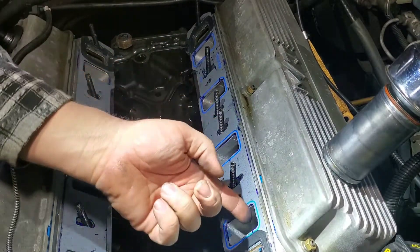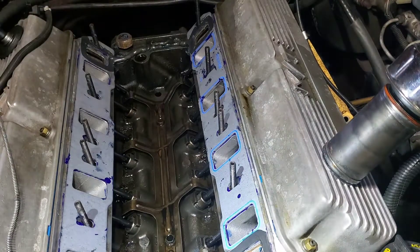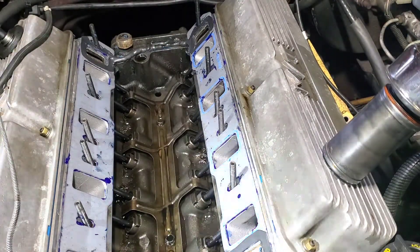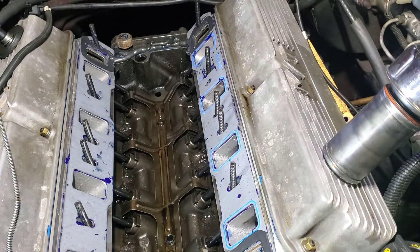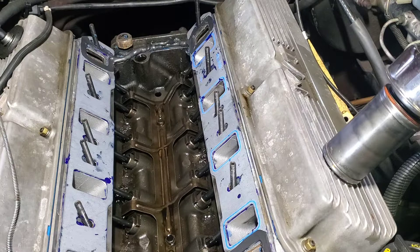Because the gasket has to stay high — you can see here, that's the problem. The gasket, when you tighten the intake, the gasket is proceeding — it's being pulled down, and this we can't have. So I'm going to make a gallant attempt to lube up the intake so the gasket won't have a tendency to want to slide.